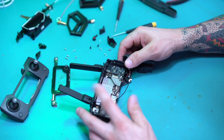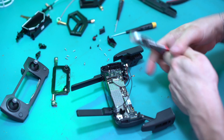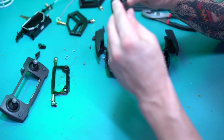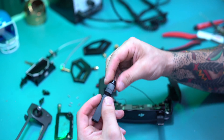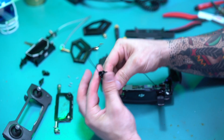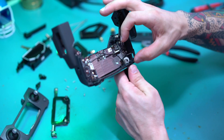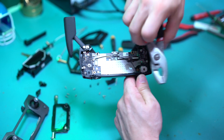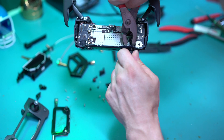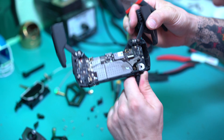I'm going to go ahead and try to save them. If I can't, not a big deal. So that's saving one of them. If I really, really ever want to go back, I can put these back in and they should stay. I mean, this is slightly damaged, but I do have to pinch it to get it out. Do the same on the other side here — I'll twist it a little bit so I have a good angle on each grab while I'm doing it. Be careful with the flat cable right there too — if you damage that, then this whole thing is for nothing.